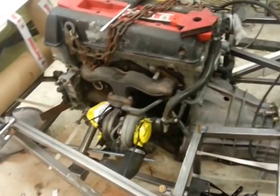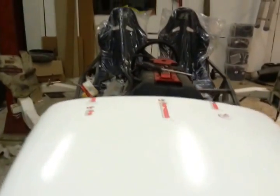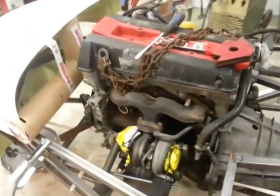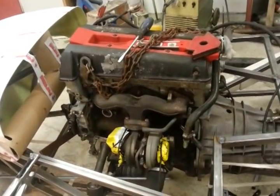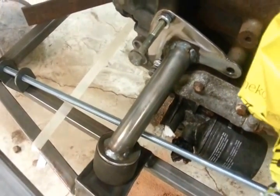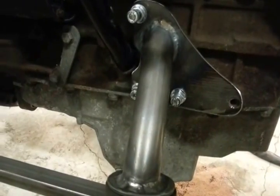I did put the engine in. I'm not 100% happy with the position — I did straighten the engine up a little bit, but it is not 100% level as you can see. That was a compromise, because the gearbox is not 100% level either — they tilt the other way. So either you get the gearbox straight or the engine straight. I will probably lower the engine and gearbox roughly 10 to 15 millimeters and set the engine a little bit straighter. These are the engine mounting points I have welded together — one side was MIG welded, while on this side I TIG welded it, just to see the difference.